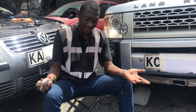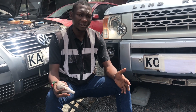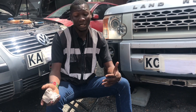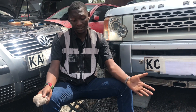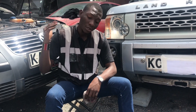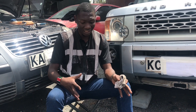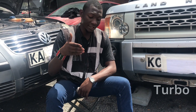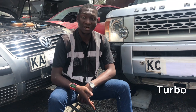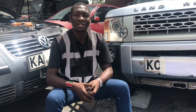Which one should you pick? There is not really a big difference in pricing, and it depends on your preferences. If you want instant power and instant acceleration, go for the supercharger. If you want longevity and the ability to generate more power, cars with turbos are more tunable than cars with superchargers — and that is the major difference between a turbo and a supercharger.